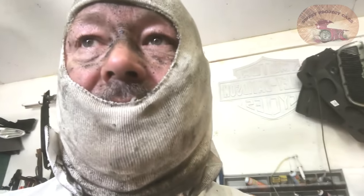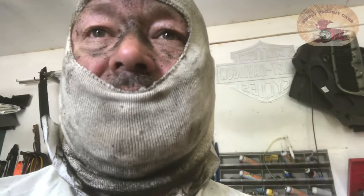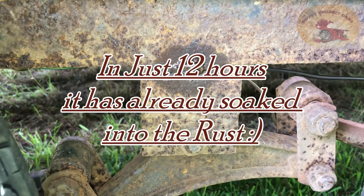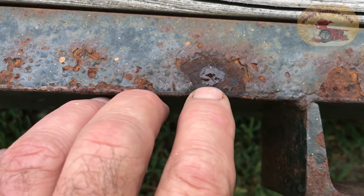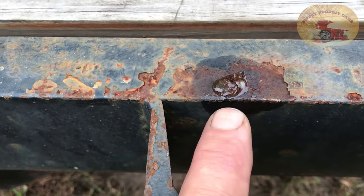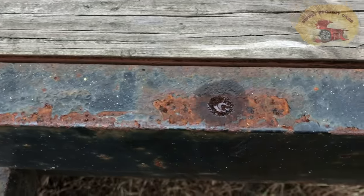You don't have to do it all at one time. It's pretty simple but it's dirty, and not every job is clean. It's cost effective — we're using the most popular rust proofer known to man for this type of DIY thing. This was just a little dot right here and look how much it's soaked in — that's why this stuff is so powerful. Here's another spot on a trailer we're doing for a customer: look how dark that is compared to this lighter one over here. That's how much it soaked right through the rust and stopped it. You can still see the glob but look how much it's absorbed into the metal and the rust.